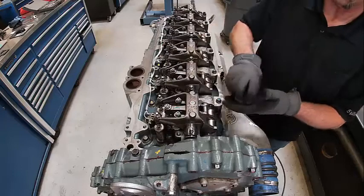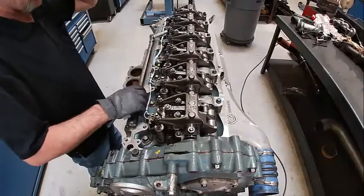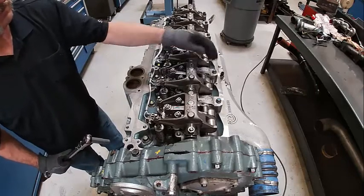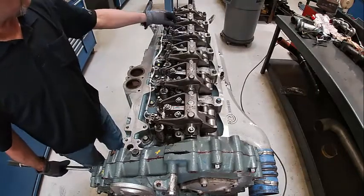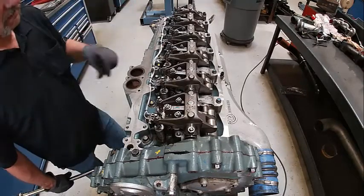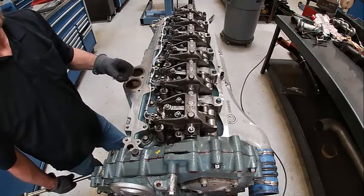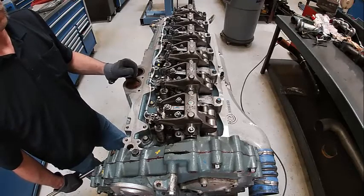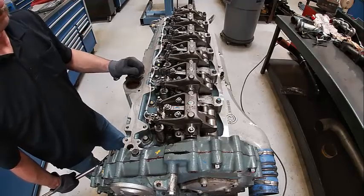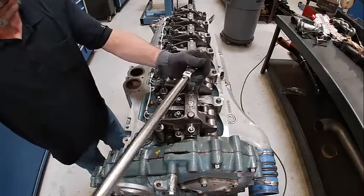There's a clamp that goes over the shaft on each end — one goes there, one goes here. Now I'm going to look at the torque specs and torque all this. I notice they're not all the way down because some of the cam lobes are up and some aren't, so we're going to be pushing valves. One thing you don't ever want to do is loosen these adjusters before you put it on. If you're putting a new rocker shaft on you'll want to, but if you're using existing stuff, I wouldn't mess with these until you go to adjust the valves — it just makes it twice as hard to figure out how to set them.